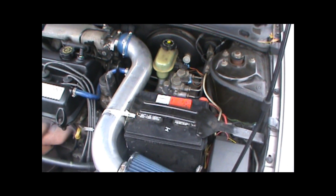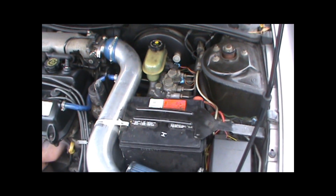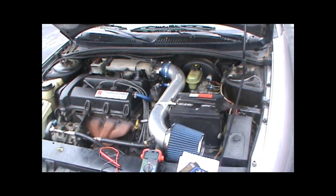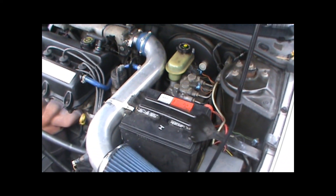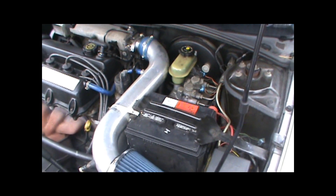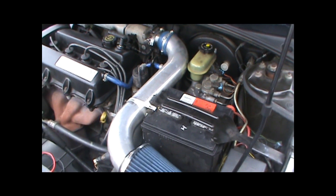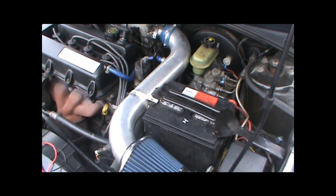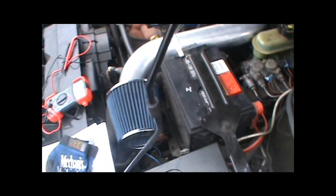The first step would be to locate your battery in your car. The battery isn't always going to be under the hood, like it is here — on an American vehicle, most of the time it's under the hood. But on BMWs, you'll find the battery actually sitting underneath the trunk, underneath the wheel well in the back, and you can access it through the top of the trunk. On Mercedes, you can find it under the rear seat on the passenger side or driver side. And in some Daimler Chryslers, you'll find it in the rear or in the front quarter panel by the tire. They're all in different places.